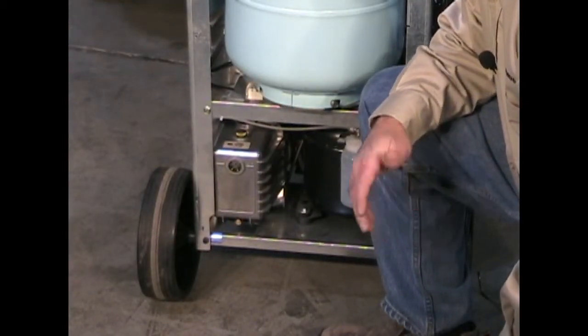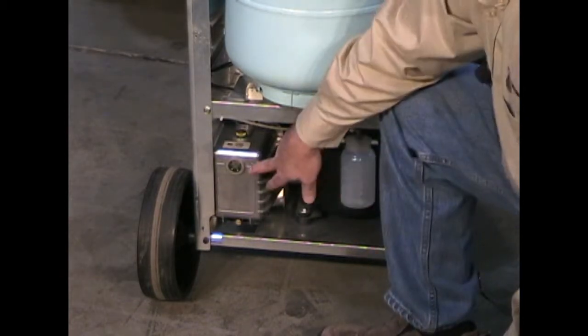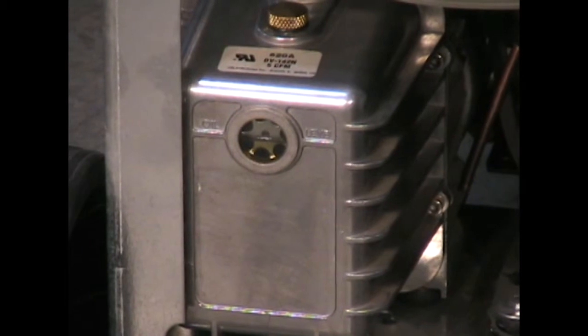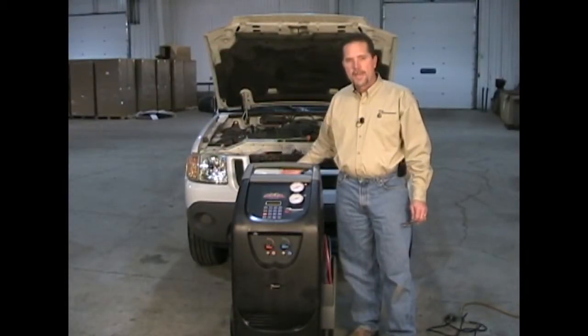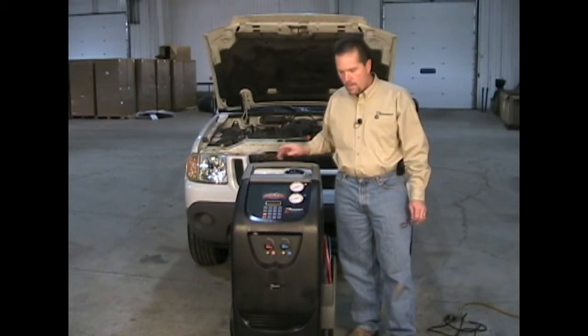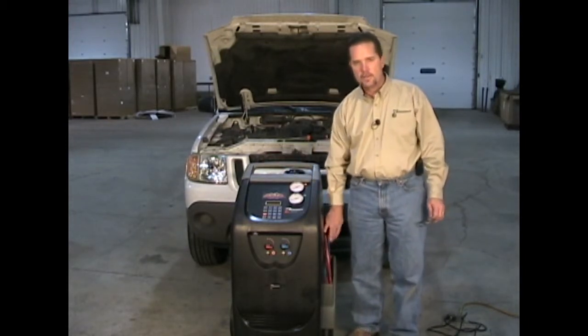While the back's off the machine, it's easiest to see the vacuum pump oil level. You want to make sure your vacuum pump oil level is up to the level markers. We have placed the back panel back on to the CCST 200 and we're now ready to connect the system hoses.